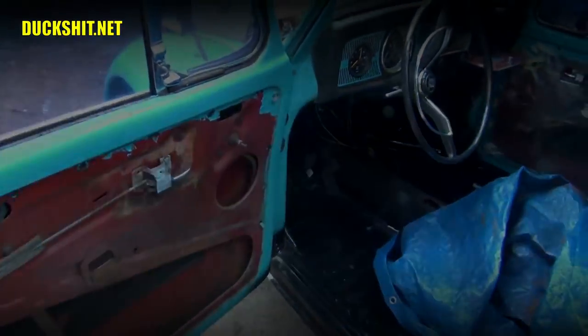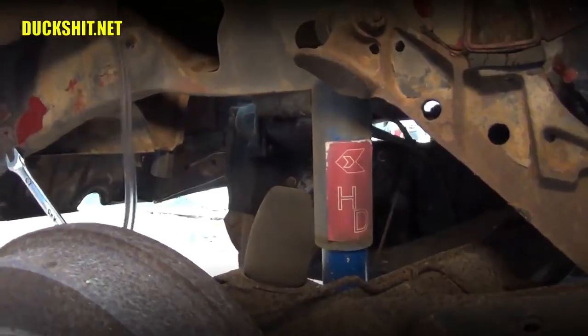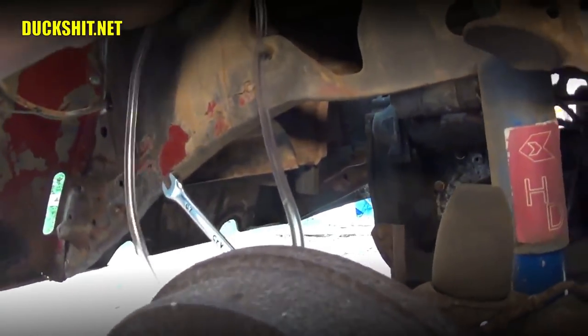Let's grab that hose. Okay, back here at the bleeder screw on the right-hand rear side, I've got the wrench put on first, so that way we can easily loosen it. I've got the hose slipped on the nipple next. Then you want to take this hose, and you want to route it up. And up is important because air bubbles will rise. So find a way to put it up and about.